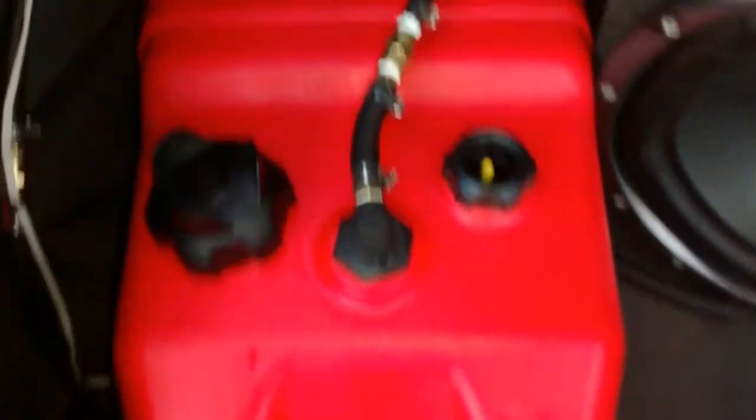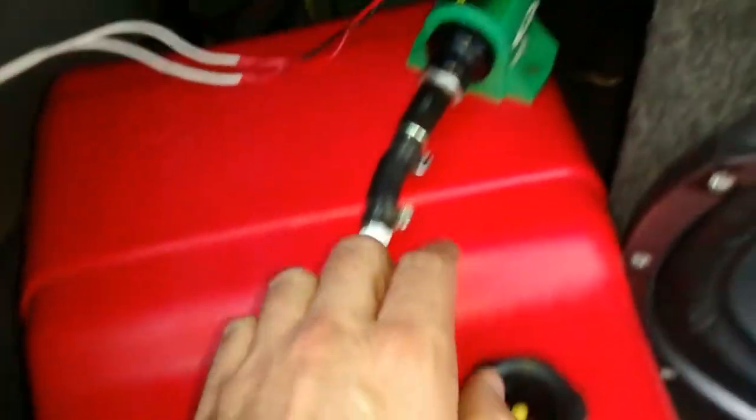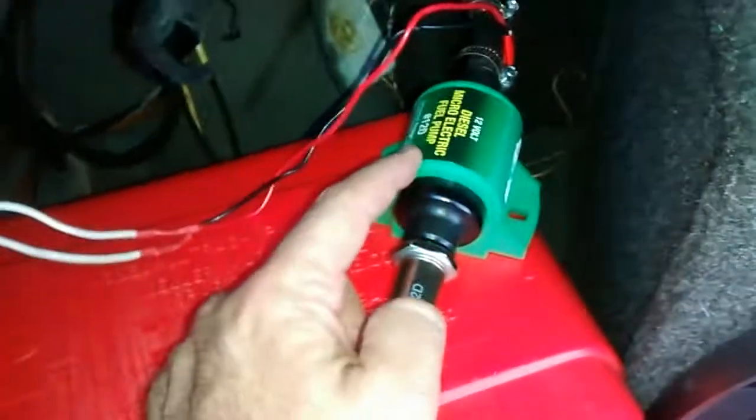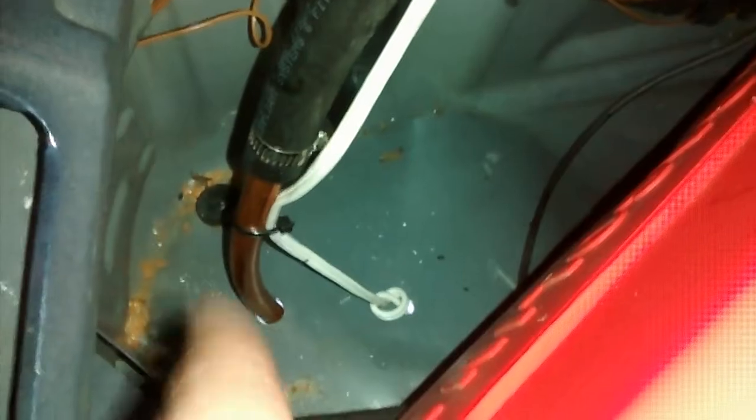Here's how it works. You have your oil in here, it comes through here. You've got a boost pump — it's about 2 to 7 psi, pulls around 2 amps. It routes around here and goes into the copper hard pipe that goes underneath the car all the way down.